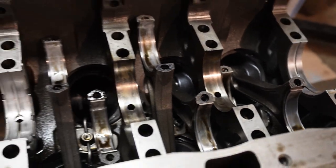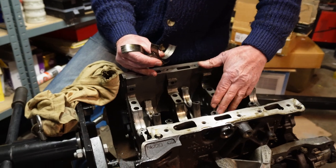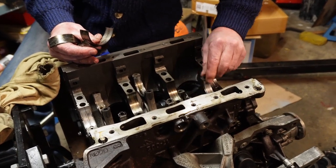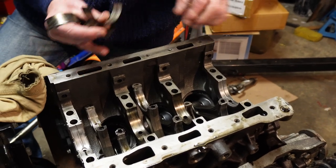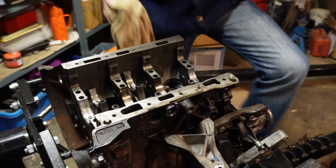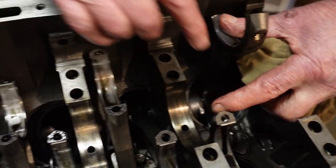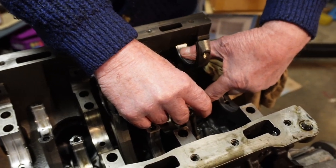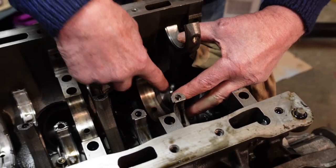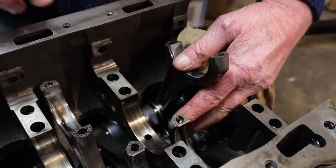My opinion — I wouldn't go again with this engine. I wouldn't bother. You'd need it line bored, oversized shells, maybe cold welded. I just wouldn't risk it. To me, this block has had it. Now inside this engine you've got cooling jets here — you've got cooling jets in each cylinder. They spur oil into the bottom of the piston to keep it cool and also to oil the small end. You can see the actual jet where it would spray the oil onto the small end, or gudgeon pin, and also spray into the piston to keep the pistons cooler.